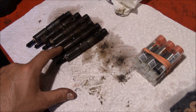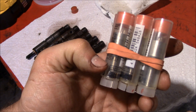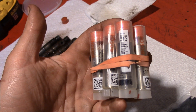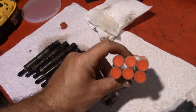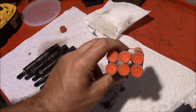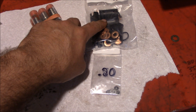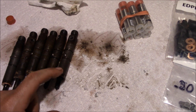Alright, time to get down to rebuilding. These aren't too bad to take apart — you can look up the specs. The caps come off and that's where you replace the innards with the little needle and the nozzle. I was able to score a whole set of Bosch OEM parts for $22 a piece off of RockAuto — I bought the last six they had. These are the lower horsepower ones so there's probably not a whole lot of people looking for them, but you can't argue with the price. We also got a generic install kit and some shims for adjusting pop-off pressure if needed.